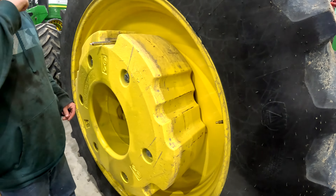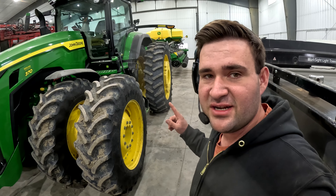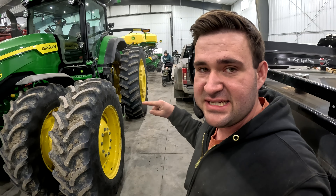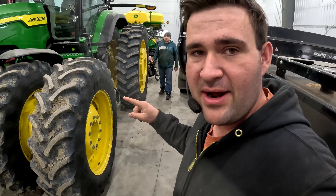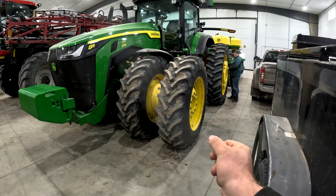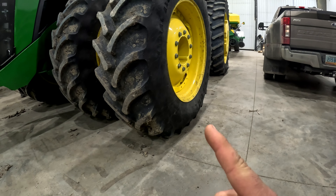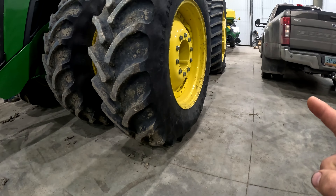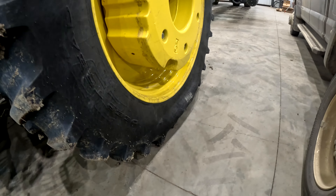I already checked this one. We're going to lower the tire pressure. Brandon is curious since these tires are aired up at 27-28 PSI. In the field we can run them down to 6-7, and down the road he said 12 to 16. We dropped them down to see what they look like. Here's the before, here's the finished product. The fronts were at 28 and we brought them down to 17 and a half, 17 and a quarter — not a whole lot different.